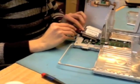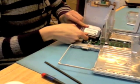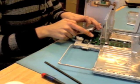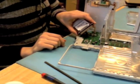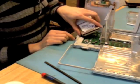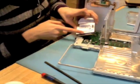And now I can just gently lift up the hard drive, slide it out of the carrier from the other side. Now I can also tell that this hard drive has been removed because the little strap here has been broken. It's so sad. But that's okay, because unless you want to break the flex connector, never pull from this strap anyway.